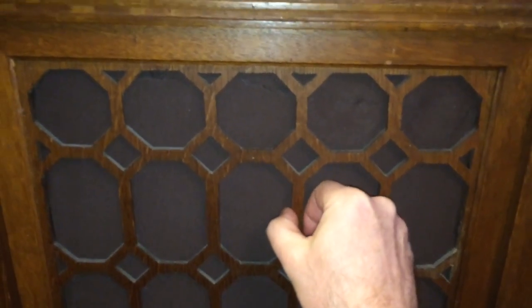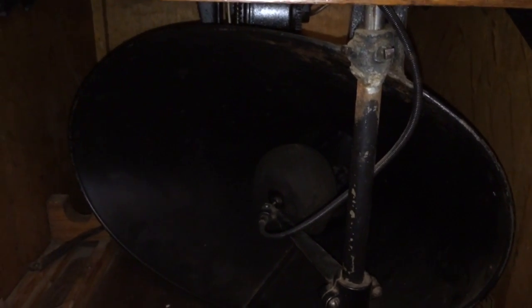I'm going to remove my camera from the tripod to show you the inside. On the front of the unit, you have this cover — grab it by the center, lift up, pull it towards you just a little, and drop it down. On the inside, you'll see the horn that actually does the playback — it's where the sound is coming from. There's a cable attached to it, and at the end of the cable is a little muffling ball. When you move the control to the right, it pushes the ball up into the middle of the horn, softening or muffling the audio. When you open it wide, it pulls the ball out.